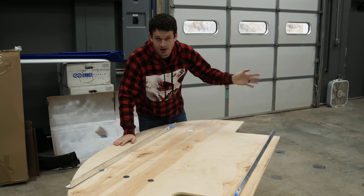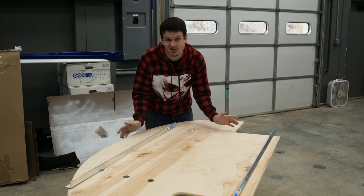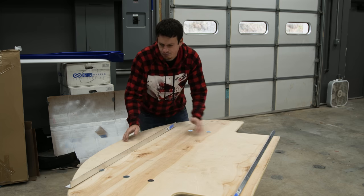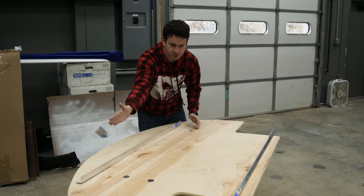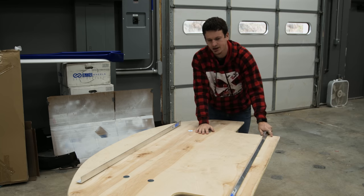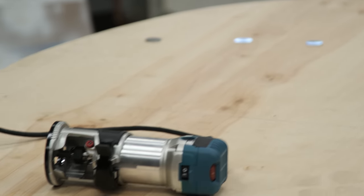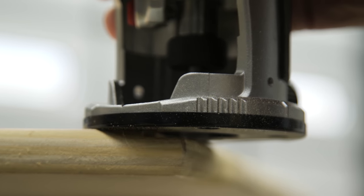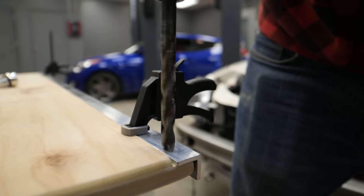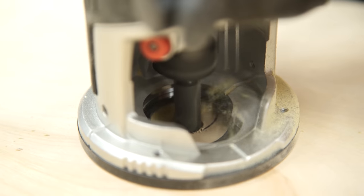While we're waiting on the bodywork to get painted, I'm going to put some extra support bracing onto this splitter. The guys at Professional Awesome said that because we made it so thick it doesn't actually need a ton of bracing, but I like going overkill and I'm still underweight on the car. I have some angle iron to put straight across to prevent the splitter from bowing over time. Because I want the bottom of the splitter as flush as possible, I bought a router to route out holes for the elevator bolts and slots for the bracing. I'm using carriage bolts to keep the bottom end slick, and I'll route out the elevator bolts to sit flush on the bottom as well. Every little bit helps.